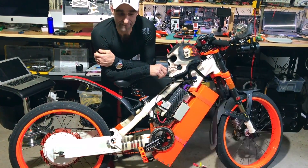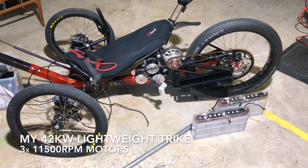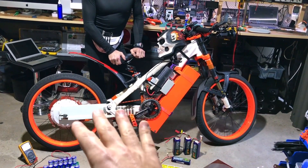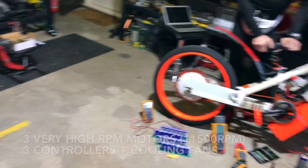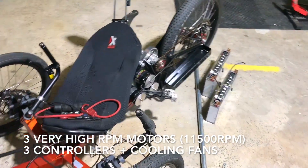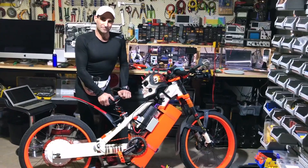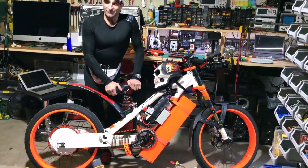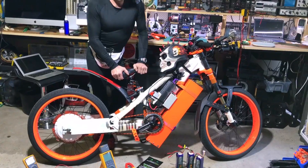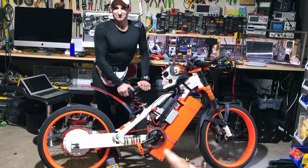This is video one, because we never made a video. Video two will showcase this bike. We're going to compare it to my trike — very different performance. This bike is more like a Tesla with traction control: super smooth, super silent. My trike is like a screaming V8, out of control, doing a burnout. Up to maybe 100 km/h I will smash him, then he'll take off and I'll be watching hundreds of meters behind — because of field weakening. My controllers are very crude, like a carburetor; this bike's controller is much newer, like fuel injection.